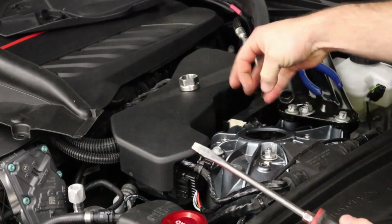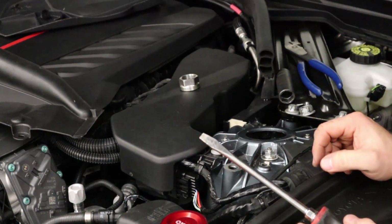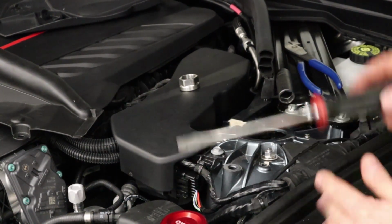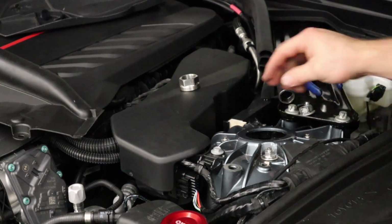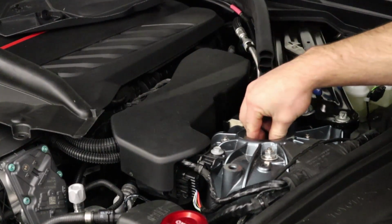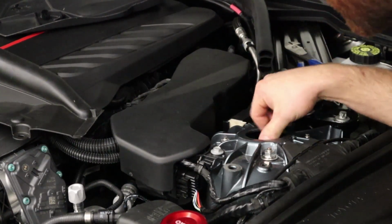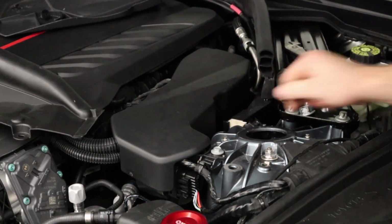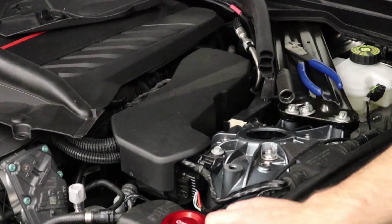You can move the spherical around so that the entire assembly will go up into the spherical, because it's a very, very tight fit. With a little bit of tweaking and not using much strength at all, the strut went through the spherical, and now we can install this. I'm going to go get the electric impact, and then the camber plate is more or less installed, and then we can start adjusting camber from here on out.